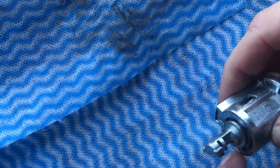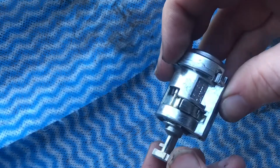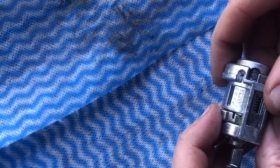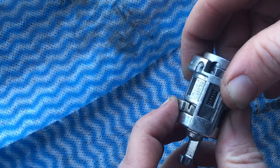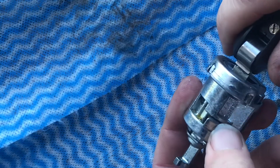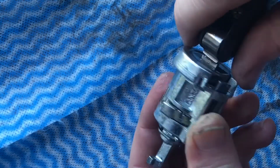Just a quick video on how to repair a Fiat Ducato ignition barrel. They're pretty easy to get out. You just pull the casing off, turn it to accessories or on and push that down in the actual lock casing and it comes out. You turn it around and that one pushes in and then the whole barrel comes out.